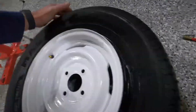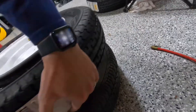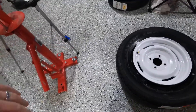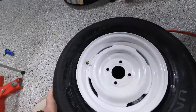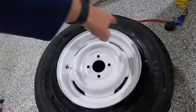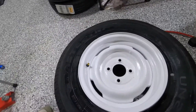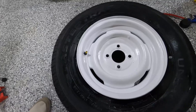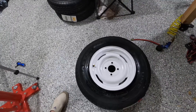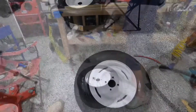Next, you want to get this square. I'm using an old tire — you could build a platform, but I don't know if that makes a lot of sense. I'm just using the old tire I had, making sure it's centered. Basically we're going to apply a lot of pressure to get the front rim sealed around the tire bead. It works pretty well. I'll get my compressor fired up and then we'll jump on this to get it into place.